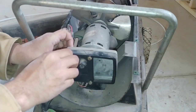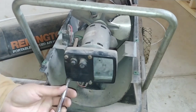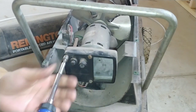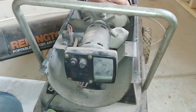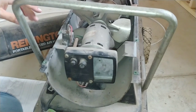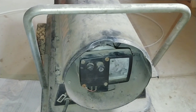I know this is a Remington 100, but honestly I've taken about three of these apart and they are all the same — they all have the six screws that hold the center housing on and the four screws that hold the outer housing on. A lot of the newer ones: this centerpiece on the back is completely round, but as you take it apart it's still the exact same. Again just checking the fan, making sure it's spinning. I'm going to go ahead and set the top back on — eight screws total — and then we're going to try and fire it up.